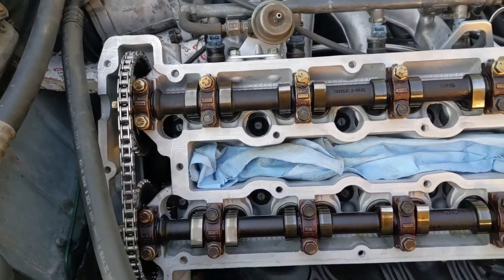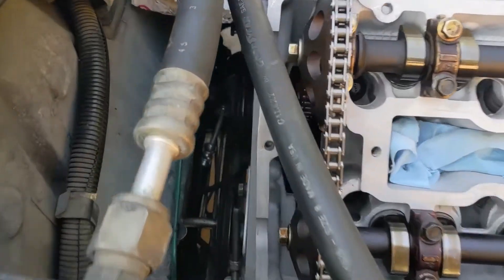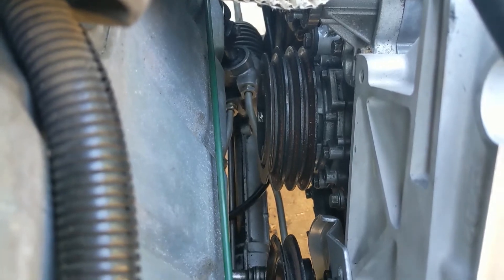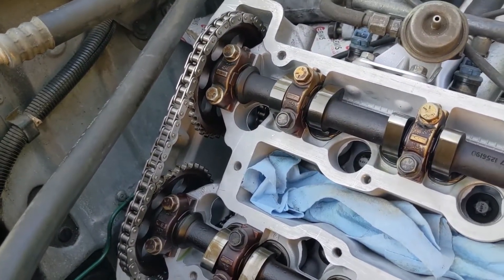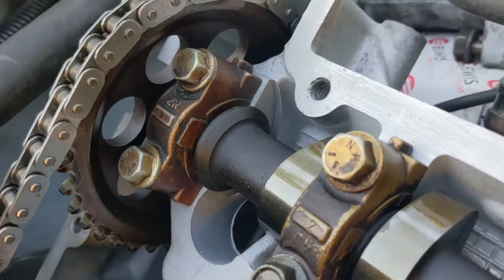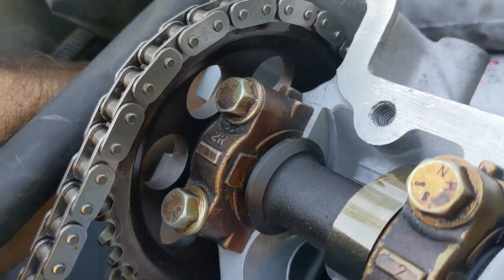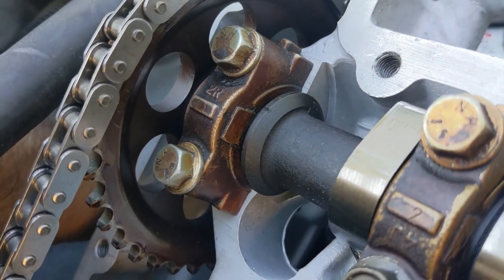This is an '87, so this takes a 30mm socket. The later cars - 1990 and later - use a 27mm socket, but it's the same tight restriction. I've also removed the AC pulley, which you're probably going to need to do to get the socket in. What I've done already is cranked it over about 10 times, which is gross overkill. Rule of thumb is about five, but I did about 10. It's just about ready to come over on its 10th time, so I need to get my socket down here under the crank pulley and crank it over that last little bit.